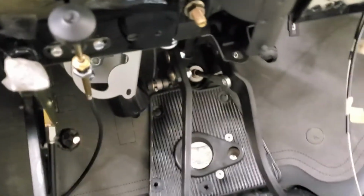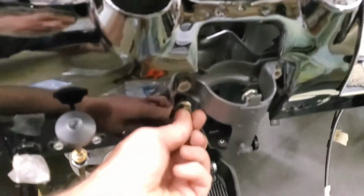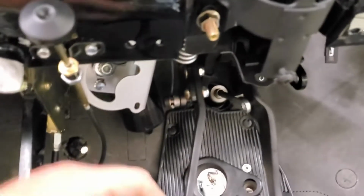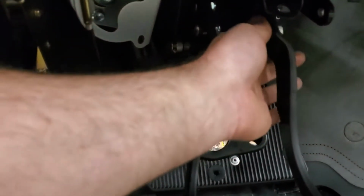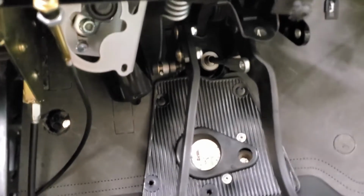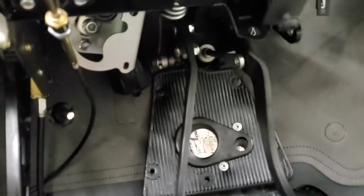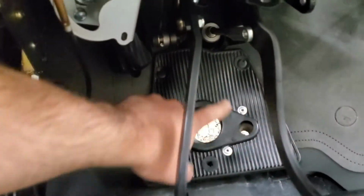Okay, we've got the pedal box completely installed now. We've got the column drop in. This one you can't use because we've got this wiper motor in there in the way, so it's just a bolt, but it's still plenty strong enough. I didn't pin the brake in because who knows if you got to pull it in or out a few times. The clutch is working, so that's good. And we got the start on the new pad.